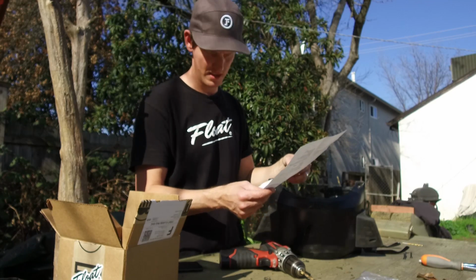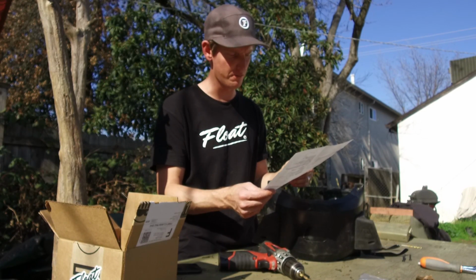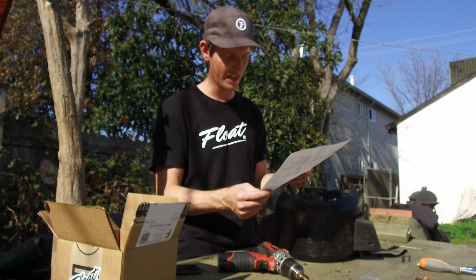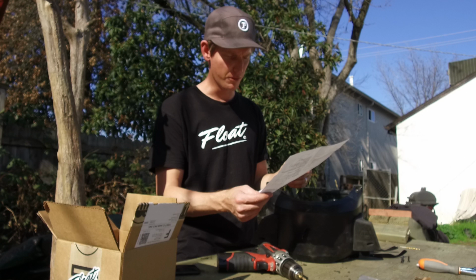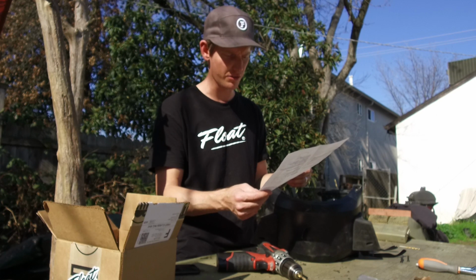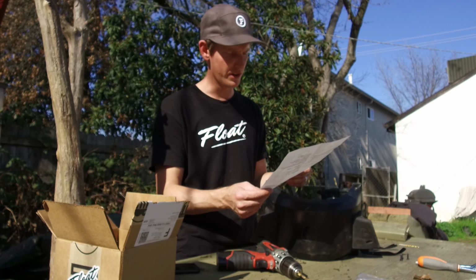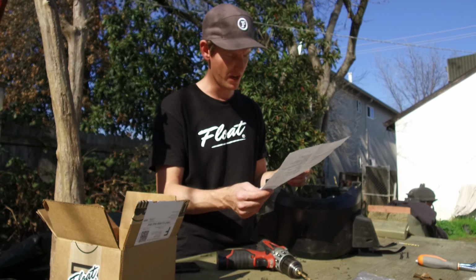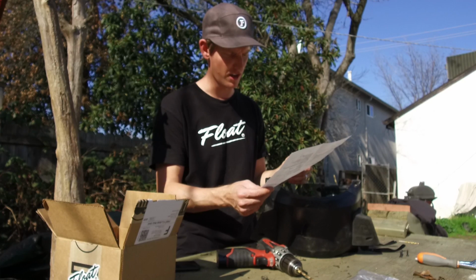Step 7, making final adjustments. With the Onewheel powered down, place the fender back on and roll the board back and forth to verify that the bolts are not contacting the wheel whatsoever. If the bolts are contacting the wheel, you will hear a slight scraping and you will be able to visually see on the wheel where the bolts touch. Always make sure the bolts are flush with the lock nut. Helpful hint for added protection, use low to medium grade thread lock on your fender screws.